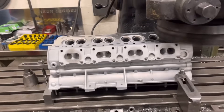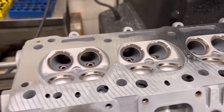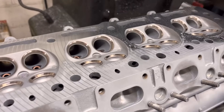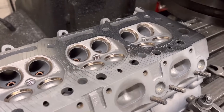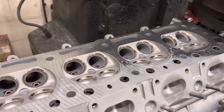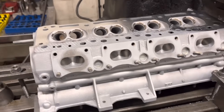So in a minute we're going to head over — Isaac is doing the Mercedes engine, I think he's sizing and balancing the rod, so we'll have a chat with him in a moment. But yeah, you can see on the Cosworth head here, we'll stick another couple of thou on that, and you can see there where it hasn't cleaned in the middle — that basically means the head is bowing slightly. It's just a classic trait of it very slightly overheating, and you can see around the firing area where the gasket's sort of eaten into it — that's another trait of the thing getting fairly warm at some point. So yeah, with the seats cut, we've put the new valves in, vacuumed them, they're all vacuumed perfect, he's got the springs — so that is Steve's job done, so I'll give him a bell in a minute.